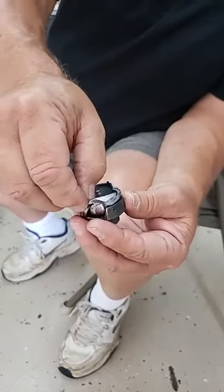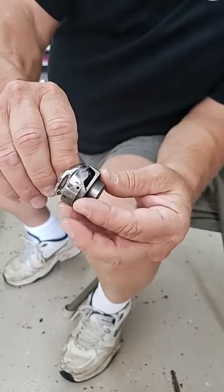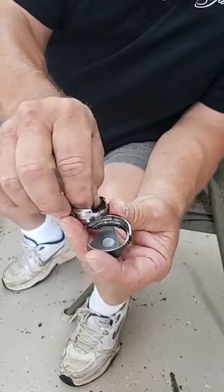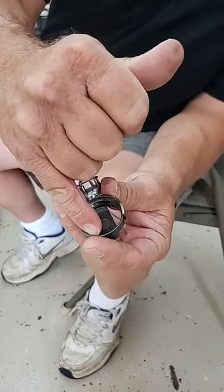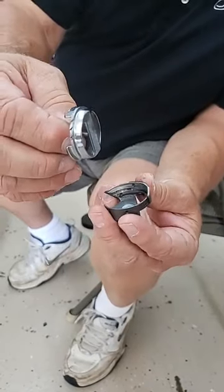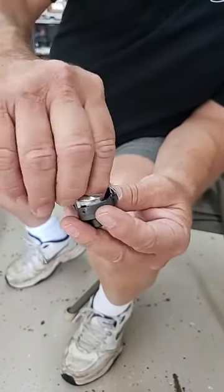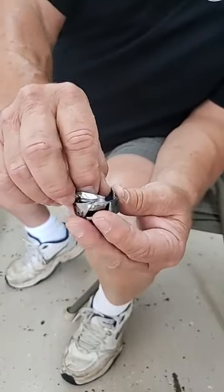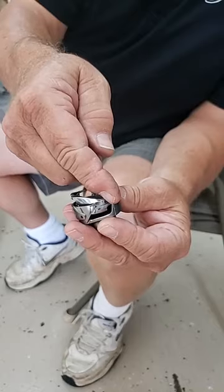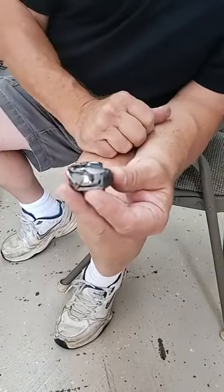So this piece is held stationary by the hook retaining bracket. I'll show you that here in a little bit, while the other piece rotates around. So what you're oiling is this little race right here, this little channel that this piece rides on. Okay? This is also where you may get a piece of thread or some lint caught as this is rotating and lock your machine up.